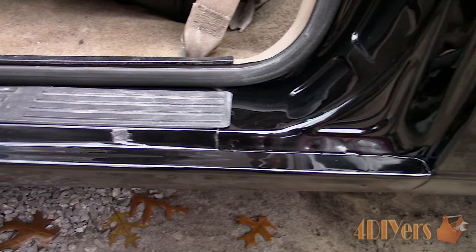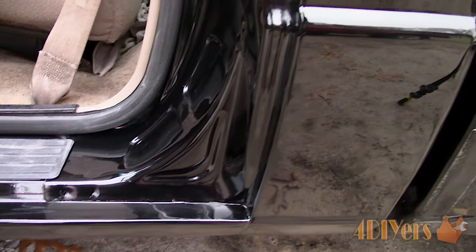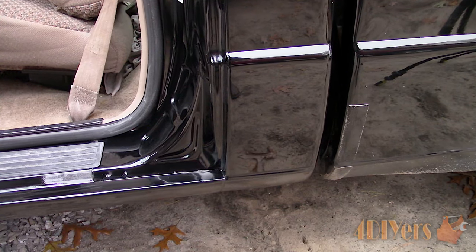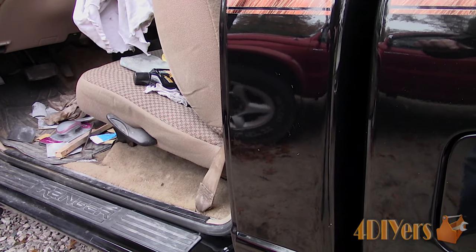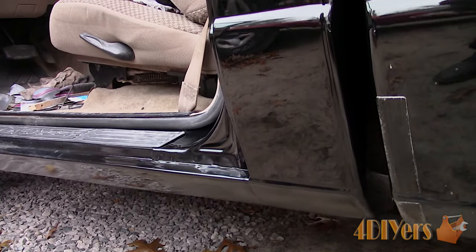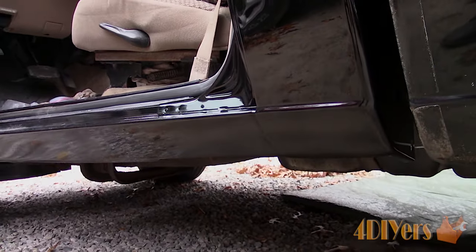After a bit more time here's the final shine. This will be the final shine of the paint and when done correctly this should maintain a shiny finish. As for wax or other types of paint sealant, this should only be done when the paint is fully cured. Cure times can range anywhere from a month or longer, and this varies between paints, weather, thickness, and quality of products used.